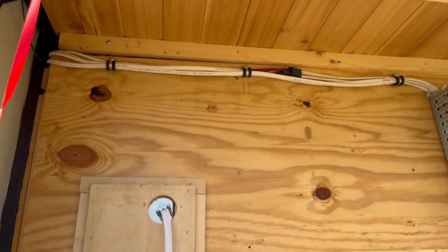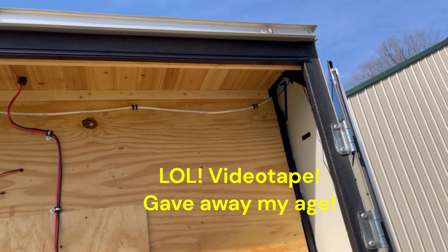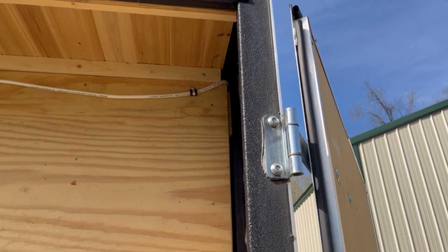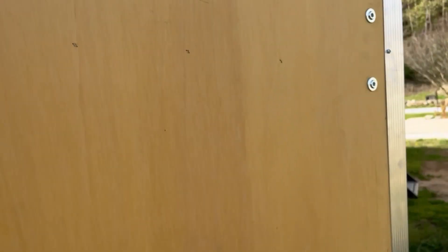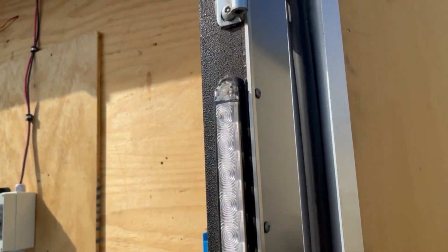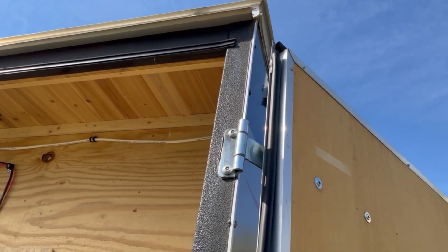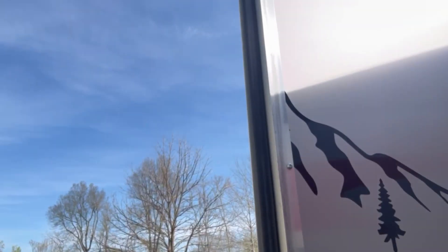I just got started when I decided I probably ought to be videotaping this, in case this works for somebody else. But you can see what I did. I've stopped — again it's kind of hard, black on black — but I'm like an inch over, so that the trim on this side will catch this outer seal of the door. Actually this seal here. So I'm going to pull all this off, because this gap here is going to create an opening even when it's squished down to the new seal — just a tiny opening and the water is in. So I'm going to take all this off except for the bottom and then the center sections here, which go top to bottom. I'll leave that be.